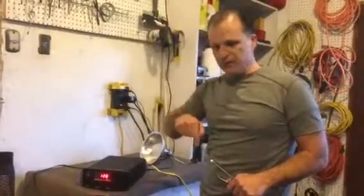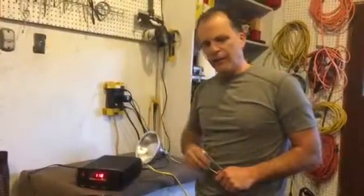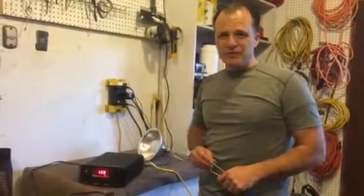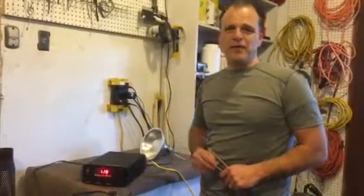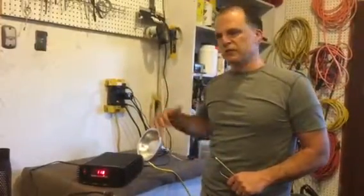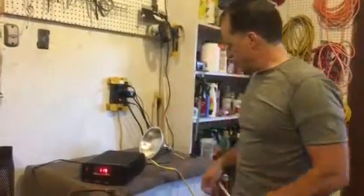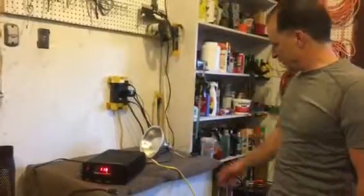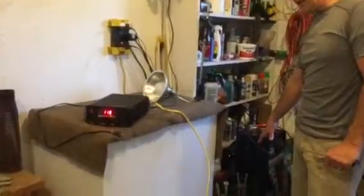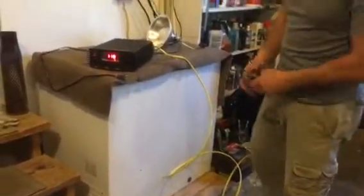As I pulled the fuses out I could see that they were burnt — one of them was leaving plugs in, and one of them was burnt crispy clean. So I felt pretty optimistic that by replacing them I might be able to fire the thing back up. Long story short, four fuses from Shucks — I put them in and hooked it up using some house wire to a car battery I had laying around.